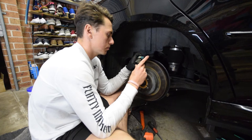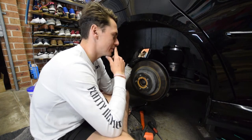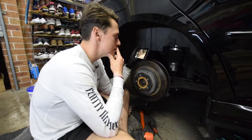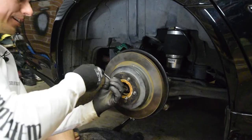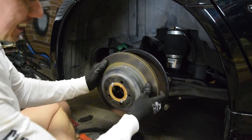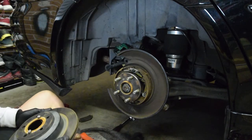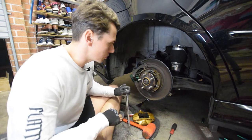I didn't want to listen to that. I watched a YouTube video on how to get that rear rotor off — today showing you how to replace the rear brake pads and rotors for a Subaru Legacy between the years of 2003 and 2009. Remove the caliper mounting assembly — yes, I've done that. Use these bolts as a sort of press to get the rotor off the hub — I've done that. This just shows that I really don't have much clue; I just watched a YouTube video and really you just have to pull it off.